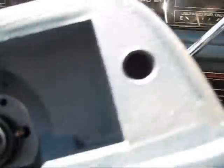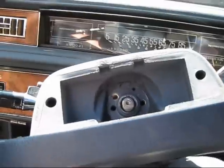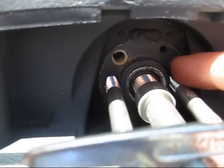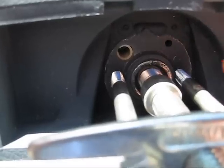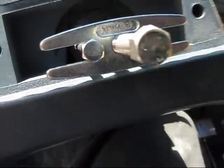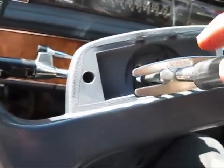And if we're lucky, we can just pull the wheel off. Nope — I'm going to have to use the puller. I've got my wheel puller installed. There's two little threaded holes on each side of the wheel here, and then you have this long bolt here. It pushes against the shaft, and when you tighten this, it pulls the wheel off. Like so.